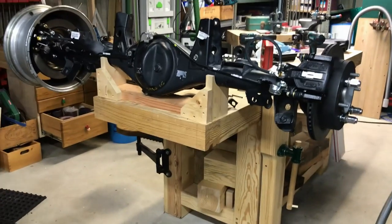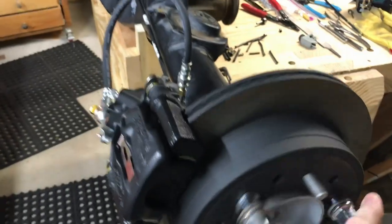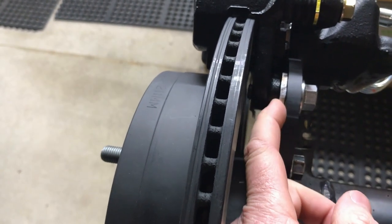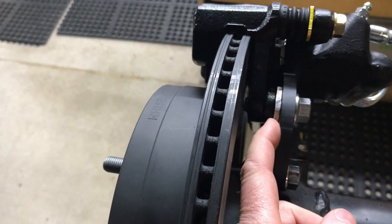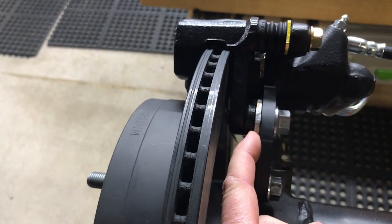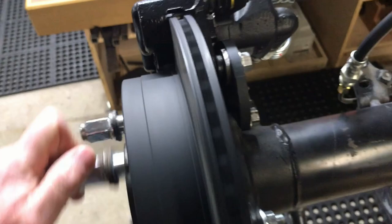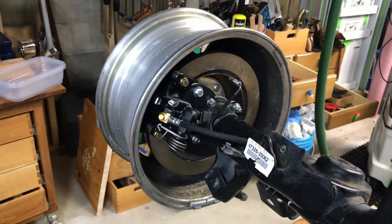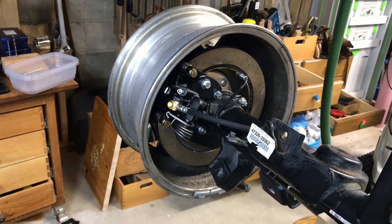I need to figure out the e-brakes but that's going to be a little while — it's like one degree in Minnesota right now. So far all the clearances look good. I modified my plan from before: this is a 4mm shim — I just took some stock steel and sanded it down to about 4 millimeters and drilled a hole in the center. So there are steel spacers instead of washers. This way I can consistently control that offset and it centers the rotor really nicely. There's no rubbing whatsoever on either side, and it fits the 16-inch wheels that come on a lot of 4Runners — I'm pretty sure it would work with most 16s, though it might not work with 15s.